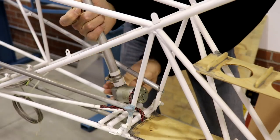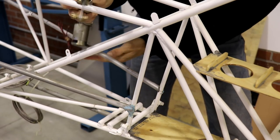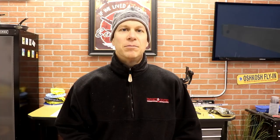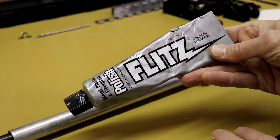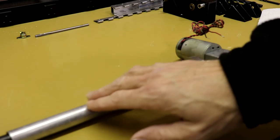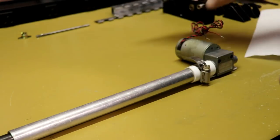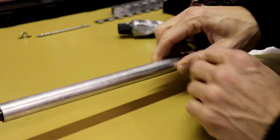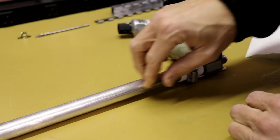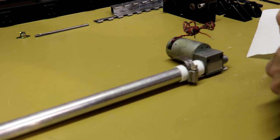One of the other things I did today was take out the elevator trim tab motor - I wanted to get that cleaned up. I wanted to show you guys this Flitz, if you've never used this before. This is an aluminum tube here and it feels a little bit rough, it's a little bit corroded or oxidized, and this Flitz is great for taking that off and making it shiny.